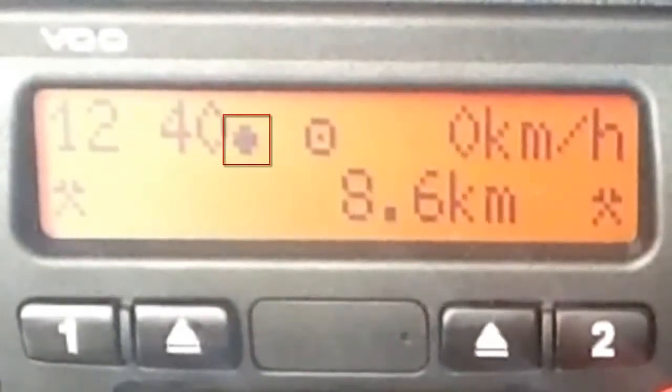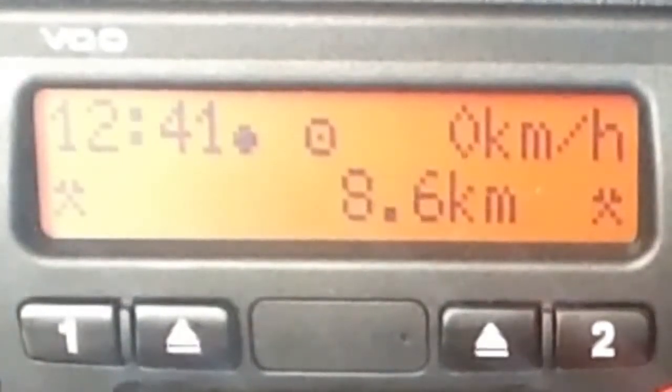The clock can also be set to UTC time. When the clock is displaying UTC time, the local time symbol won't appear. If it's something you haven't come across before, UTC time is a worldwide clock that doesn't use time zones — regardless of where you are in the world, UTC time doesn't change. Fortunately for us in the UK, it's easy to know what UTC time is because it's identical to Greenwich Mean Time. Although the clock displays the current local time, this doesn't affect the clock inside the unit that records onto your digital driver's card — that clock only ever recognises UTC time.